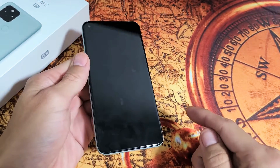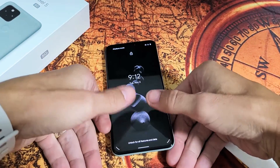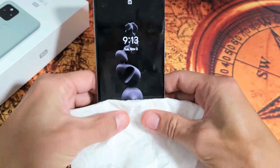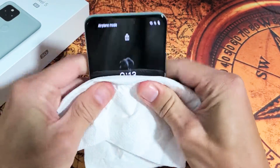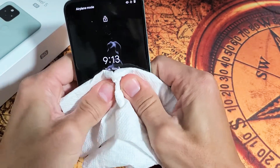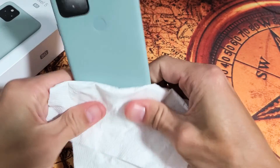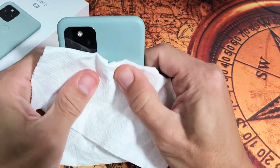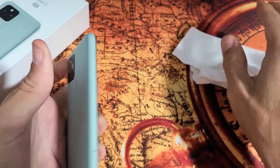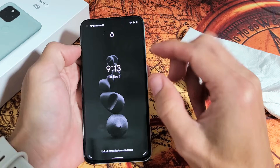If you're still down, the next thing is what I call the massage method. Go ahead and massage the screen and the back. You can use your fingers or a paper towel if you don't want to get the screen dirty. Hold the phone and press in with both thumbs on both sides. Sometimes when you do this the screen will start flashing or just turn right on, or you'll see half the screen or lines. Do the same thing on the back. Sometimes you can hear a little click and the phone may be on. Massage around the camera lens too. Then press and hold the power button until you see the Google logo appear.